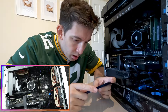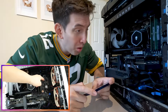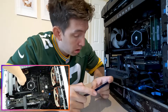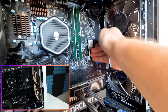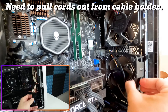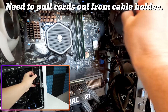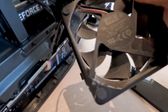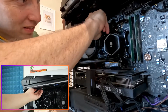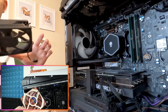To take out the case fan, we need to first unplug all the powers — here's one, here's another one, and here's a third one for the top. To take out the fans, press the blue tab and pull. For the upper one, same procedure: press the blue tab and take it out. How dirty it is. For the last one, pull up the tab, press the blue tab, and the fan is going to release.